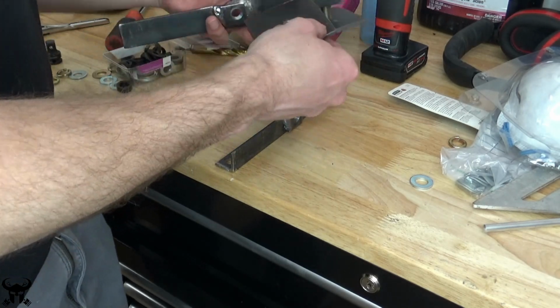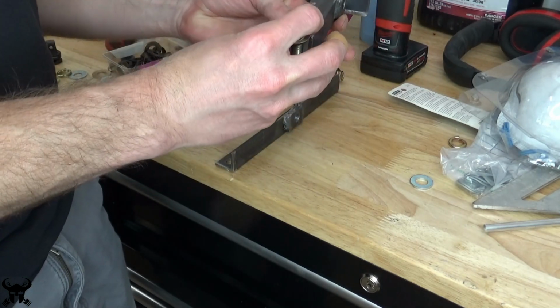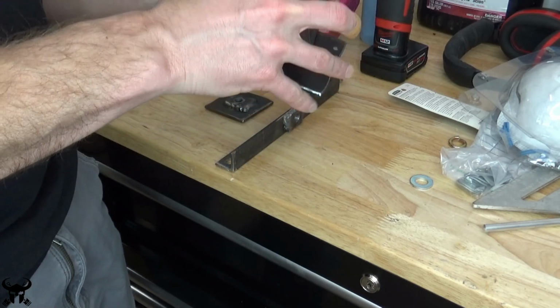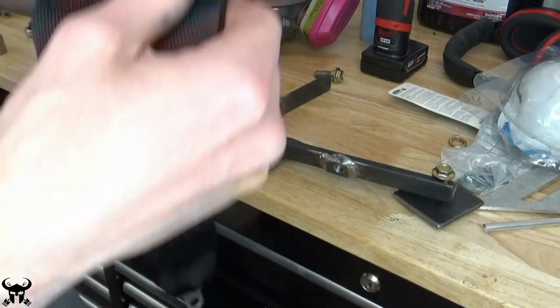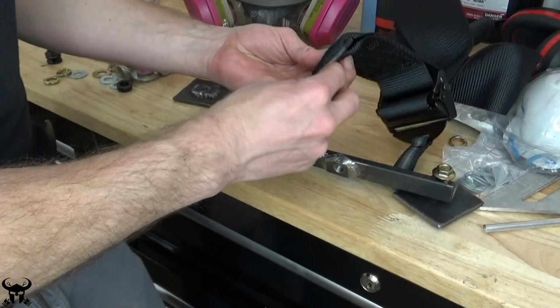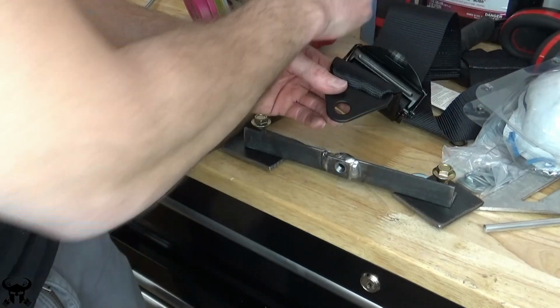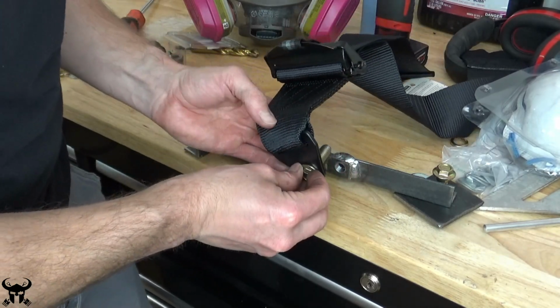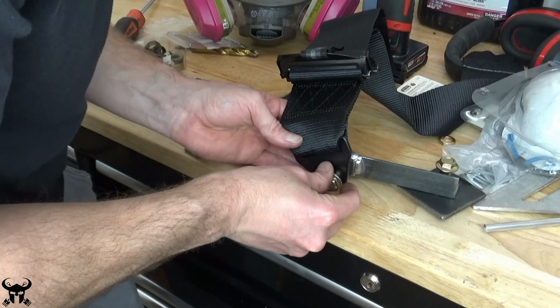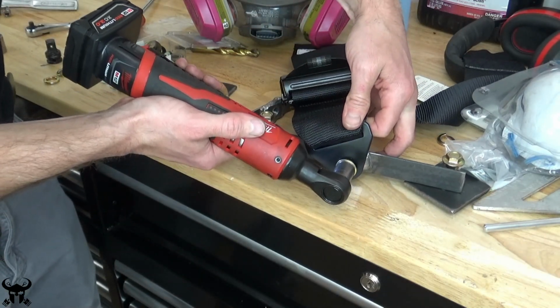These backer plates are 2.5 inches by 2.5 inches. The purpose of the backer plates is so that the harnesses don't pull through the floor in the event of a crash. Here's one of the seatbelt straps, and the bolts have a larger diameter that prevents the bolt from going too far into the hole. But you also have to use wavy washers on these to get them to articulate and not flop around and also not bind up. And I'll be posting those in a link in the description.